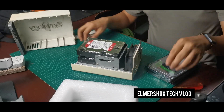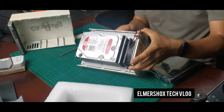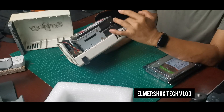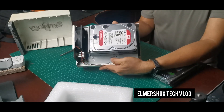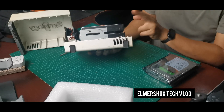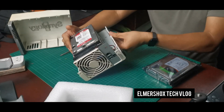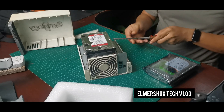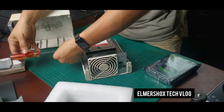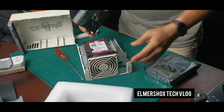It's a little bit dusty. You just need to unscrew the holding bracket. There are labels: HDD1 and HDD2. I'd like to upgrade HDD2 with this drive, or you can choose whichever. As far as I've checked, there are no errors on both drives. So I'll just keep the data inside just in case. It's simply plug and play — removing hard disk number one, the top hard disk. Just unscrew the bolts and pull it out. And that's it.